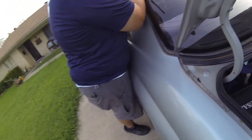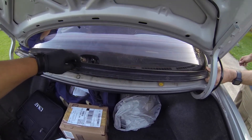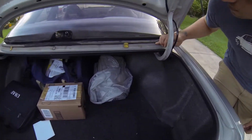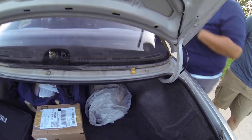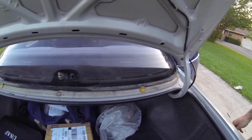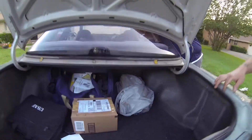It's just like the S14 — same thing as the S14. There's a lot of rust in there. Surprisingly there's not. And see these guys here? These little yellow things — they stop the glass from coming down. That way it has the perfect groove all the way around. So all you got to do really is just align it from left to right, and as long as your groove is right from left to right, you really don't have to worry about alignment from up and down.